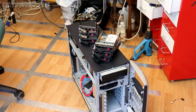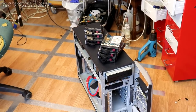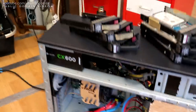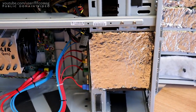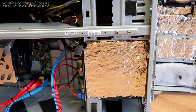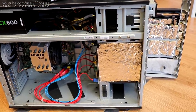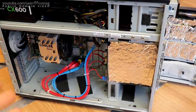I've got five new drives on order — five 3-terabyte drives. We're going to be doing a FreeNAS RAID-Z build of 12 terabytes. We'll have to modify this case a bit because I had soundproofed away all the hard drive cooling, since I knew this would be used for Windows with just a couple of drives. The low-speed WD Reds I use don't make enough heat to actually require any ventilation.